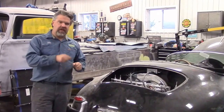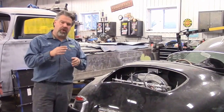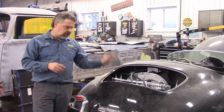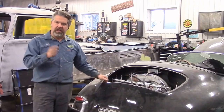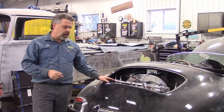We have the special oil that you use when you go to reassemble, so all the bearings were lubricated properly, and then we have the break-in oil in the car now. We've broken the engine in, we've set up the revs, we've done the duration that our camshaft people insist on having to break it in properly.